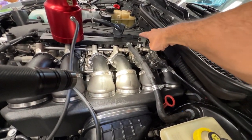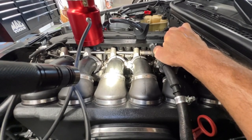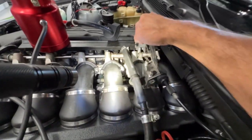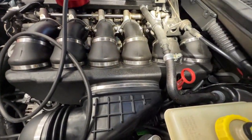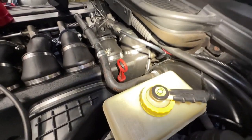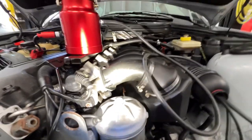Let me open the intake. Get the air up in the intake. Even though it's going up in there, it's probably through the idle air control valve, but this will just help. I used to have a lot of smoke coming out of this number 4 flange and the number 6 in the back. Put the 3 mil red silicone O-rings on there, and it did the job. I tried the 2 mil and it wasn't enough. I don't see smoke anywhere.